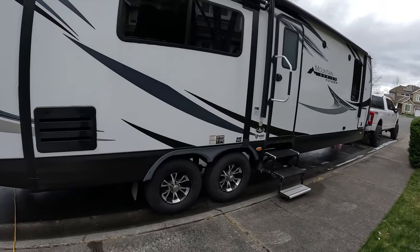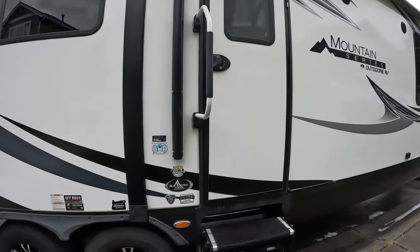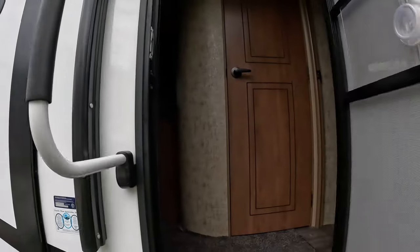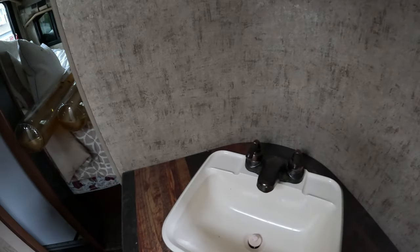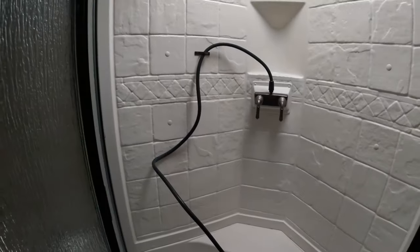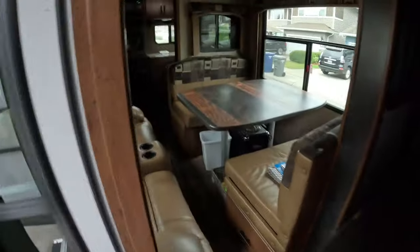We're going to make our way inside the trailer to the back where we can open up the low points. We're going to go inside the trailer here and open up some of the faucets. So when we open the low point drain, everything will drain out on the outside into the bucket. Yep, we open the faucets there. We open these faucets. Come back into the kitchen.